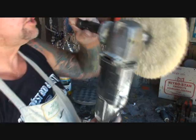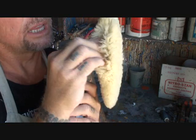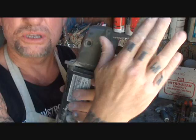You want to make sure that you have your T-handle on there. The pad that we're using is a double-sided wool pad. I want to show you something you really have to pay attention to — if you look inside, you can see the inner pad, and that's very, very hard. If you roll your panel with that edge, pushing too hard, you will cut through your paint and burn it off.